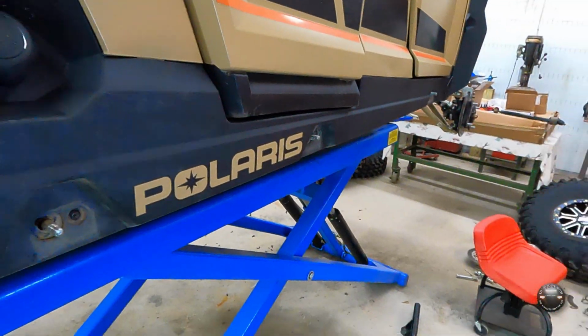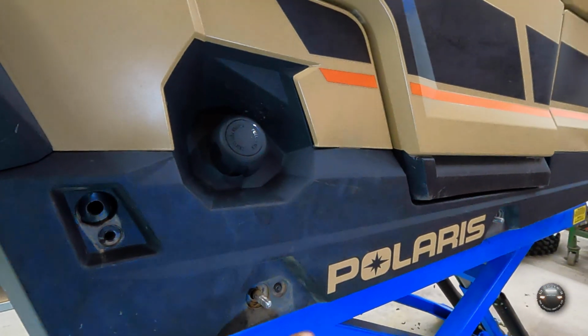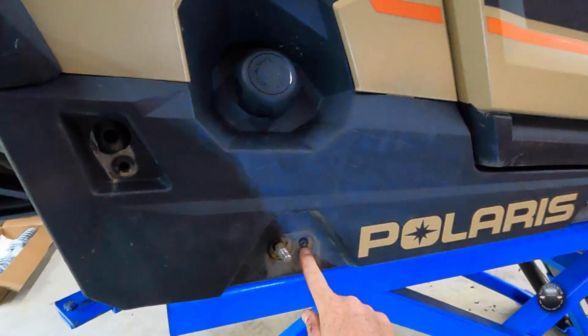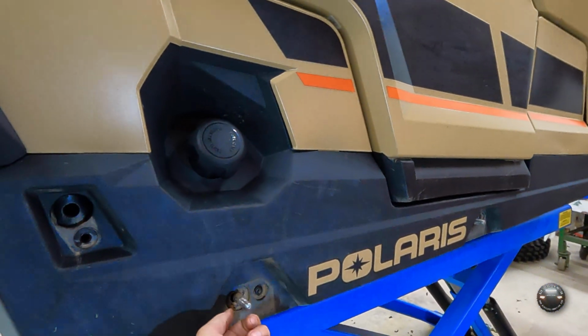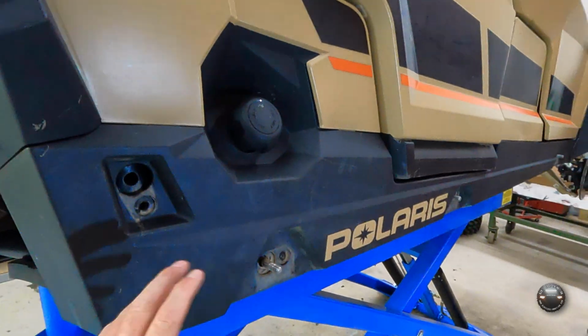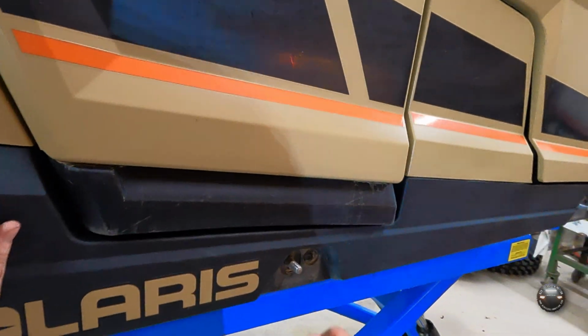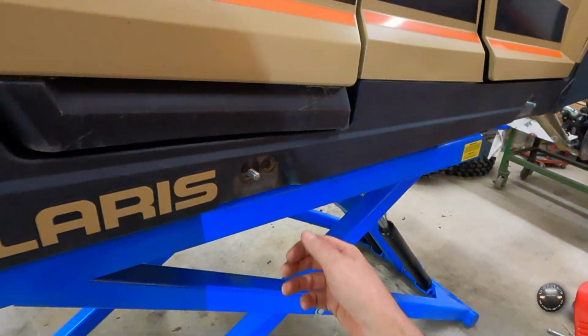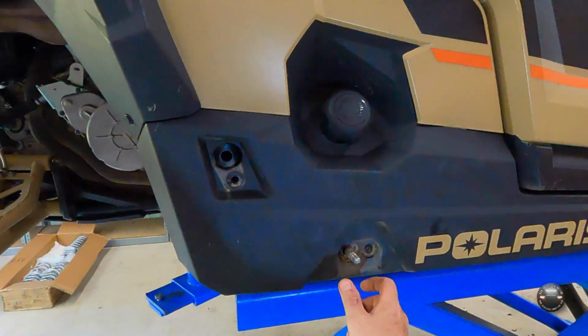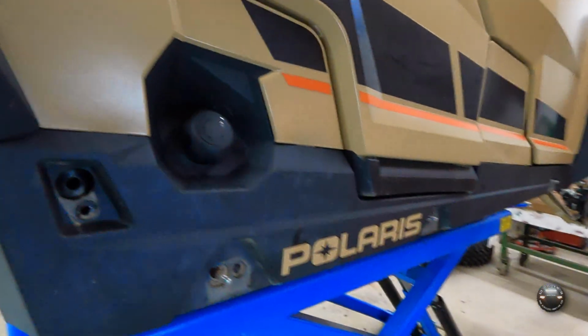But everybody else, the ones that I'm familiar with at least, uses this L bolt. The bolt, you take it and hook it inside the frame rail, and then you take this existing Polaris screw out first, and you put this in, line up the hole, and then put this back in, and that holds your plastics to your frame rail or frame tube. Now you don't want to really tighten these down all the way, because the job of this screw is not to secure this bolt. The tension pulling on these from the outside is what's going to do that, but this is simply just to hold them in place for you, basically. If these come under any strain here, it would simply just pull it right out, because that's pretty small, which is exactly what happened here.